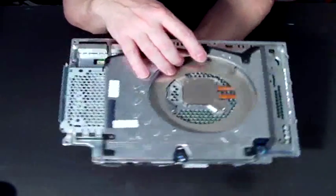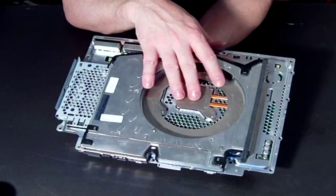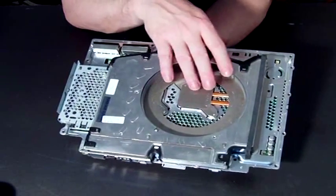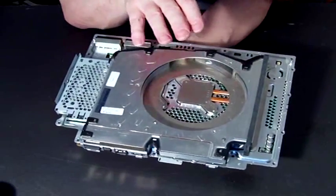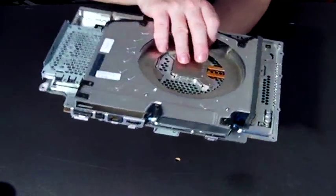This is one of the major problems that PlayStations have — the chips have been heating up and the solder has been melting, and that's what's causing the failure: the yellow light of death, the red light of death is being caused by that. So this heat sink, and connecting it properly, is very, very important, so that your new motherboard doesn't go the same way as your first one.